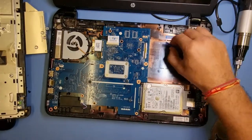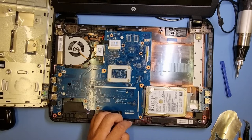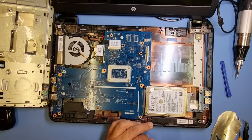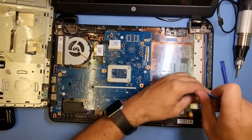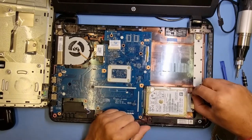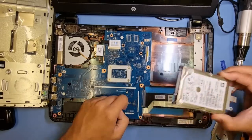There you go - that's revealed. The hard drive is here. The customer has been complaining the machine has been running extremely slow, and I've done a quick diagnostic - the hard drive is the issue. There are a couple of screws here, one there and one there, then it should just lift off. This is a very old hard drive - approximately eight years old, it's mechanical. Just take these screws out, lift the hard drive slightly, make sure you don't bend the connector, and pop it out.